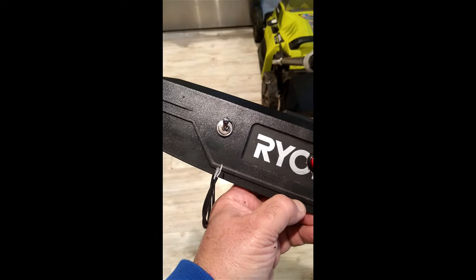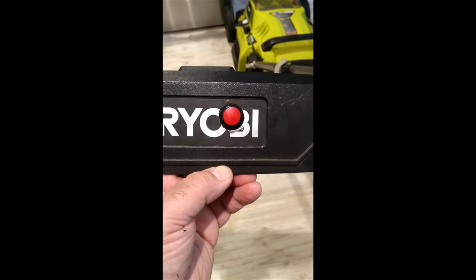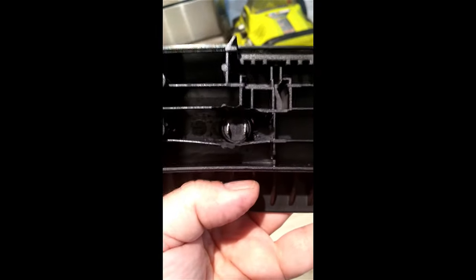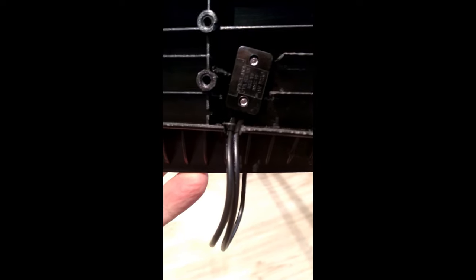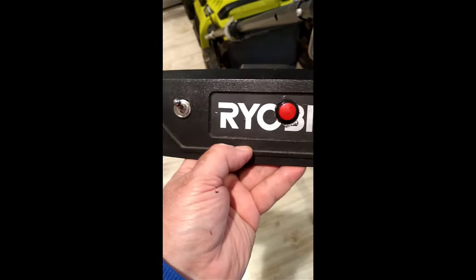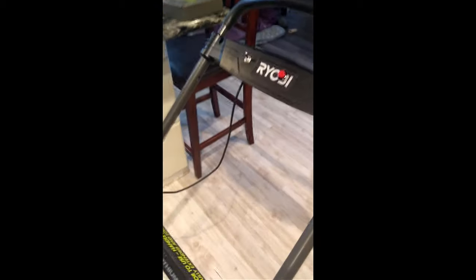Here are the switches installed. I took a drill bit and drilled into the most convenient place I could find on the back of the handle housing. There's a switch in there that wedged in kind of nicely. Just take your time, use a drill bit, and make the hole slightly larger and larger to get a nice snug fit. I had to cut out a little piece on the side to let the cables pass through — doesn't matter if it's a little crooked. I had to break those little fins left and right to fit the switch so it all fits nice and snug. That's what the end product looks like on the front, and then I just connect the cables.